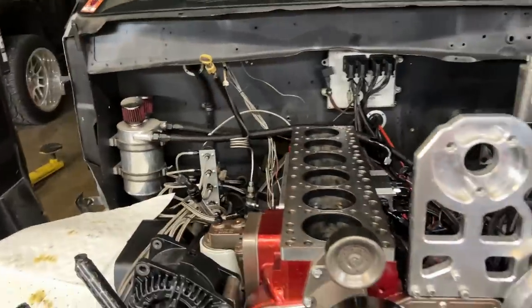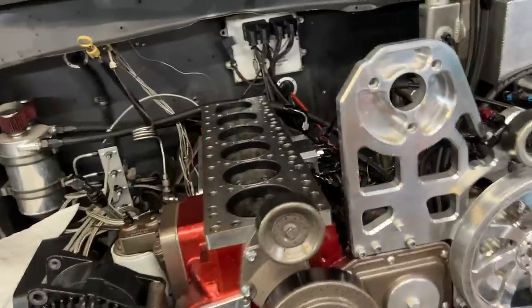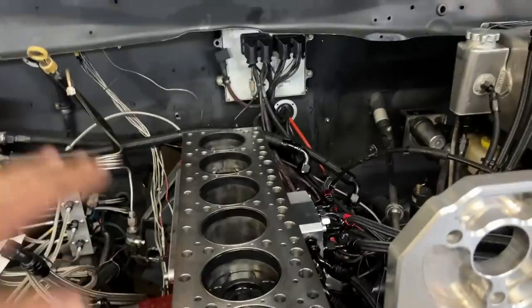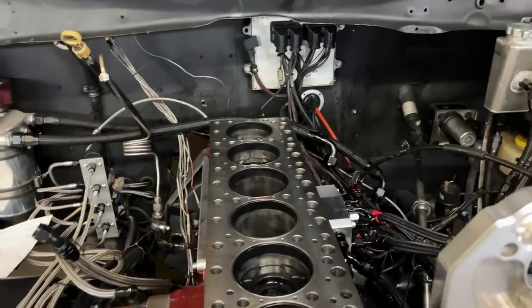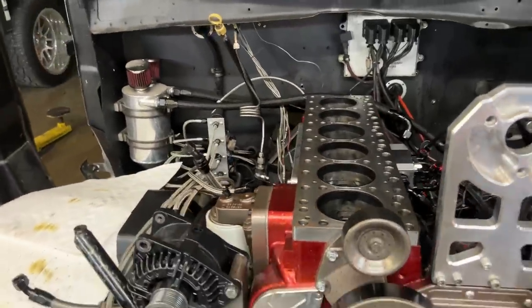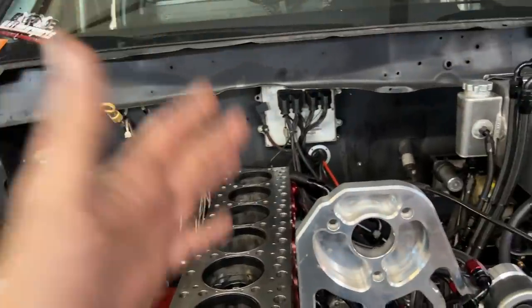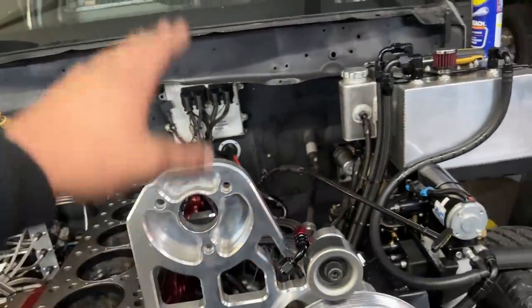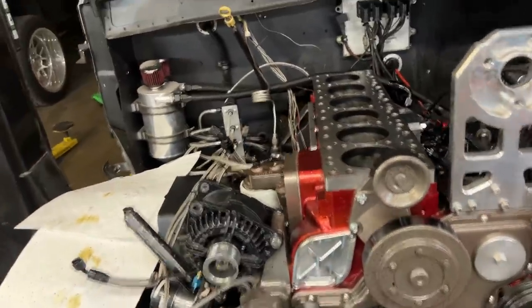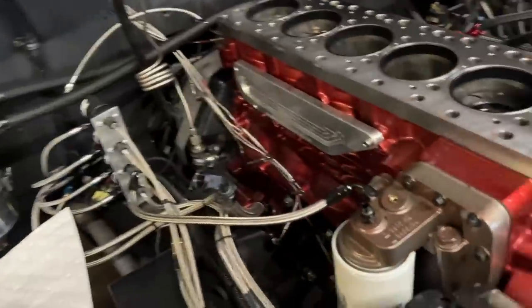I will spare you the semantics of putting it together. Basically head gasket, fire rings, head, head studs, torqued, rocker arms, push rods, valve bridges, set the lash, all of our fuel stuff goes back on, CP3 pump, rail, all the lines. On this side, the manifold stayed on, and we will just roll right into single turbo fabrication. And yeah, it should be great.